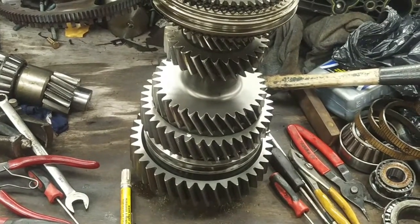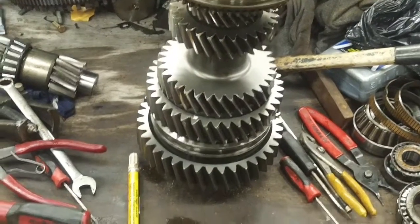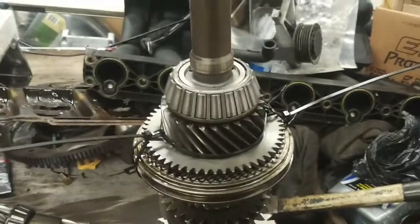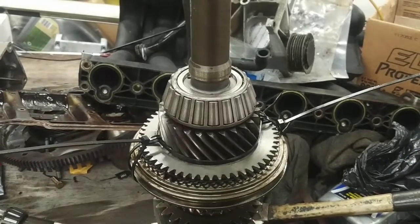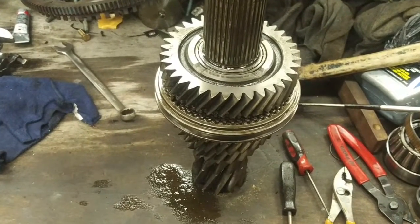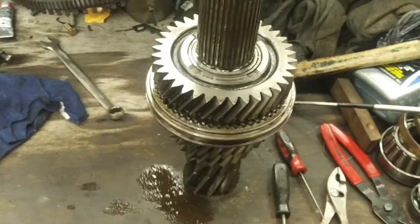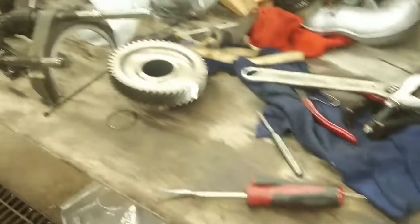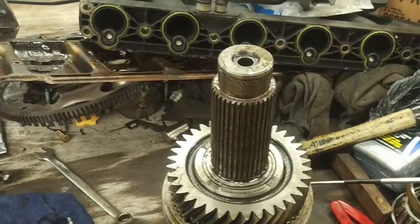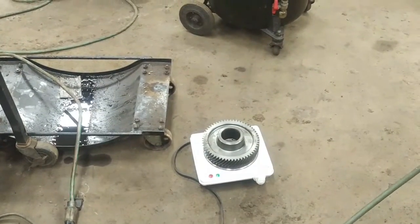Got the third-fourth synchronizer replaced — synchronizer rings and new bearings. I had to heat up that ring with the heating element and the upper bearing to warm it up a bit to get it to go on easier. There's the counter shaft — third and fourth synchronizers replaced. Those two gears, fifth and sixth, fifth gear is warming up now so that it slips on. It takes about 20 tons to press that off, so hoping that once it's warmed up it'll slip right on. We'll heat it up to about 100 Celsius and see what happens.